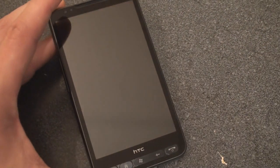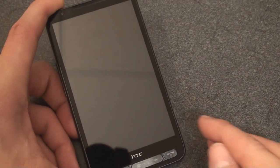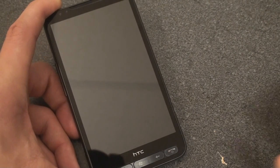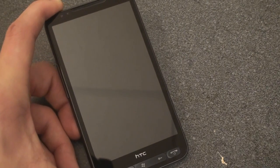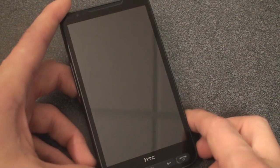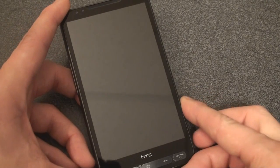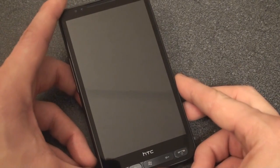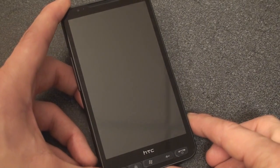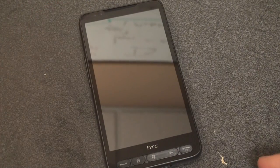Let's talk a little bit more about this screen. Obviously, it's a capacitive multi-touch screen, which is the first for Windows Mobile. It's 800 by 480 resolution, which is WVGA. The clarity is fantastic, the contrast is terrific, and the screen is made out of glass. In terms of sensitivity, it's not as sensitive as the iPhone — it's probably within the same realm as the HTC Hero and other HTC Android devices that have a capacitive display.